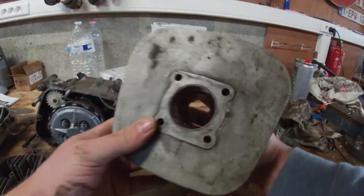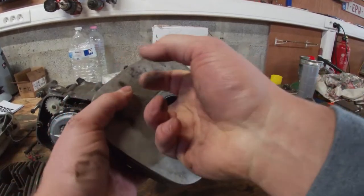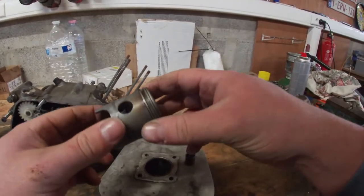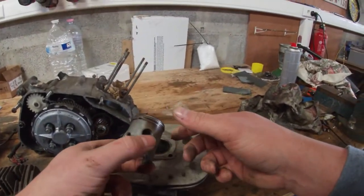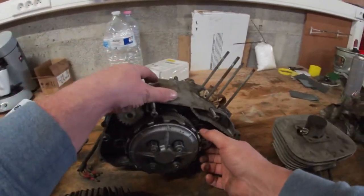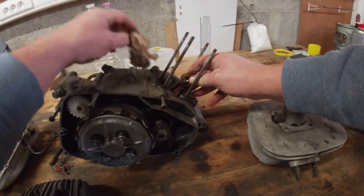The inside of the cylinder walls have some wear marks, but nothing too bad. I feel no scratches, nothing that worries me. The needle bearing looks all right. It came pretty close to overheating, I think, or maybe that's just typical for these pistons and cylinders — I'm not quite sure. Other than that, the engine looks all right. I've checked the bearings for play, there's no play at all, the clutch seems okay, and the connecting rod has some rust on it, but that's no big deal.